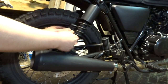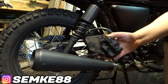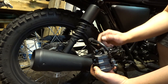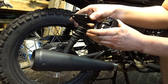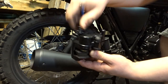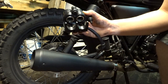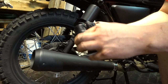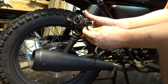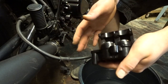To get easier access, put it through here. Now that we have the brake caliper, remove this bolt and unscrew it until it's out. Slide this off, push the pin back, and completely slide it off — watch out for the dust cover. Now remove the brake pads by completely removing these two bolts. With those removed, the brake pads come out. Remove this little piece, every single grommet — make sure you don't rip any — then remove this bolt and the grommet. Now the brake caliper is totally free.